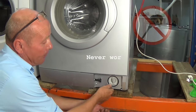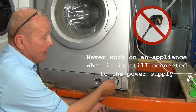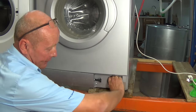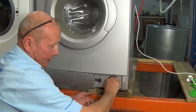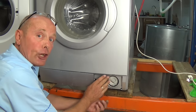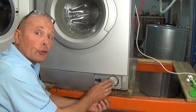Normally you would remove the pump just by unscrewing, but if it's filled with items that have fallen down from the machine and hasn't been cleaned regularly, you'll find you can't turn it by hand. As you can see, it's turning halfway but not all the way. You can try it a couple of times but if it doesn't come undone, do not try to force it — there is something in there jamming the filter and stopping it from twisting off.